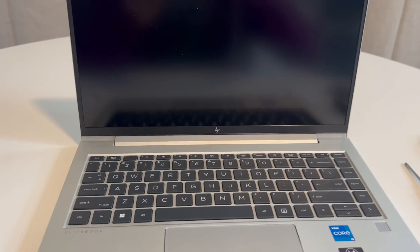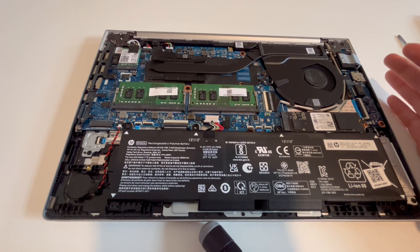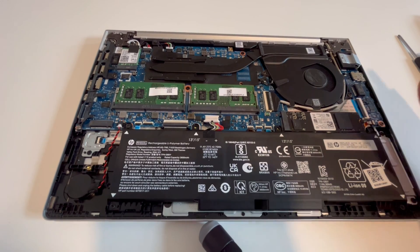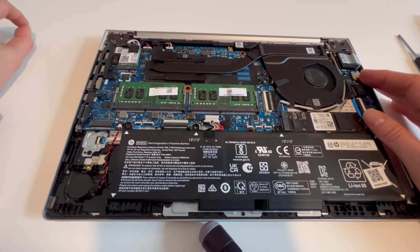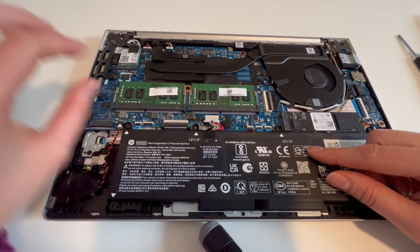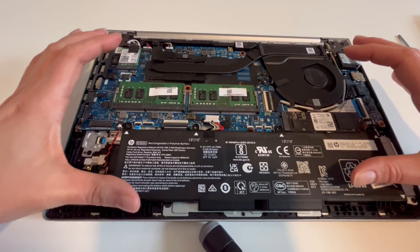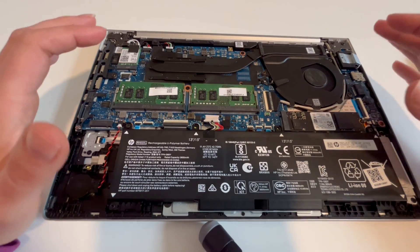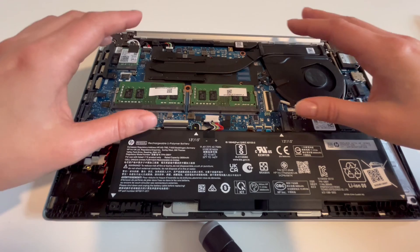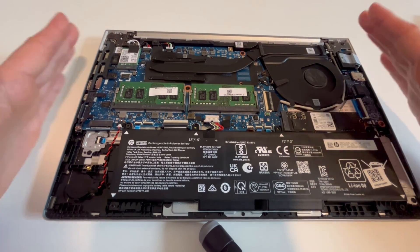So how to diagnose this? We're going to get into that right now. A really common cause is a RAM problem. What I've done is unplugged my power source and my power cord. Also, the battery is completely unplugged — you want no power going into this laptop. Keep in mind you want to touch things a minimal amount because your oils from your hands on the computer parts are not a great combination.